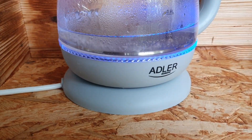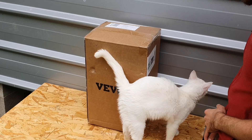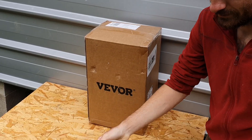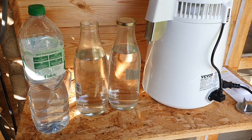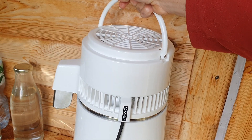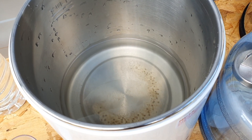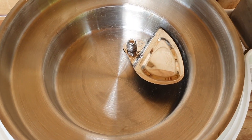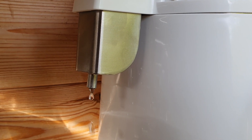When you put distilled water into a kettle, you won't get any calcium buildup — that's one benefit. Try to get the model with a timer if you can. This one is designed for filtering tap water, but I've been experimenting with rainwater and getting some interesting results. The distiller has a coil of pipe running through a heat sink with a fan on top — the water vapor escapes through this pipe. Water distillation works by boiling water, creating vapor in a sealed chamber that travels through one escape route and drips out the other end. The pipe needs to be cooler than the water so it condenses inside.